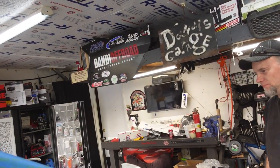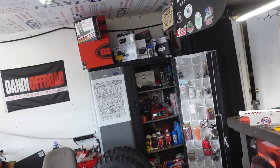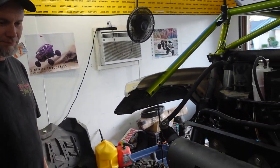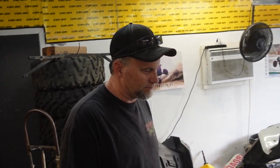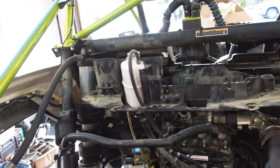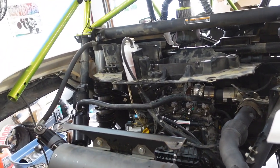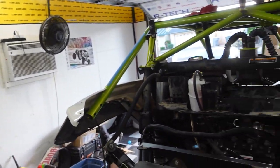It got to two bars. The radiator's cool in the front — the radiator warmed up. It didn't overheat. Didn't make any weird noises. It sounds perfect to me. Didn't smoke — not a drop of smoke out of the exhaust. The smoke we saw before was definitely coming from the turbo spitting oil out. We found it in the turbo and in the intercooler. My theory is that when the car was hot there was high pressure in the crankcase and it spit it through the seal.